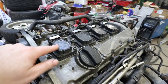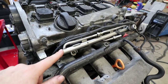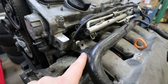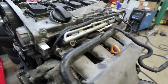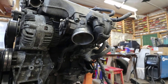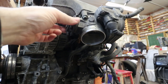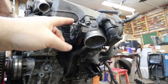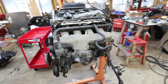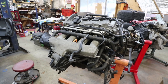At the very top you have your four coil packs for each spark plug — that's what fires the spark plugs. This stainless steel tube is your fuel rail, which has four fuel injectors going into each runner of the intake manifold. The intake manifold goes to the throttle body. One of the differences between the earlier cars versus the later 1.8 turbos is this is a cable-actuated throttle with a cable connected to pull it, as opposed to an e-throttle actuated by the computer with no physical link to the gas pedal.